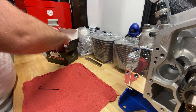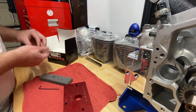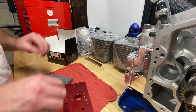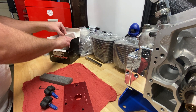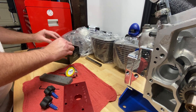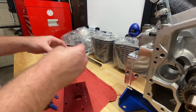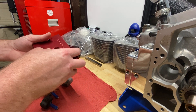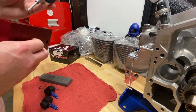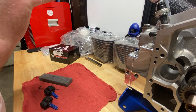In this video I'm going to measure the runout of the brand new crank. It's an S&S four and five eighths stroke flywheel assembly built by Dark Horse Crankworx. In the previous video I said the stock runout was twelve thousandths — I went back and checked and it was seven thousandths. The spec calls out for two and a half thousandths maximum, so it's time for a rebuild or a new set.